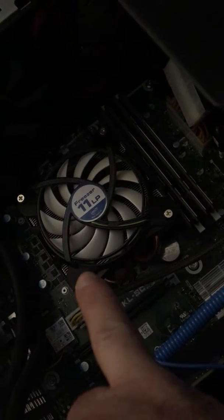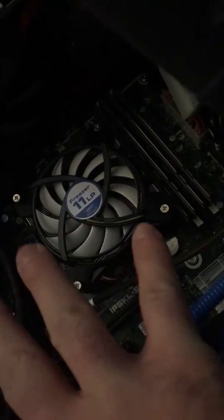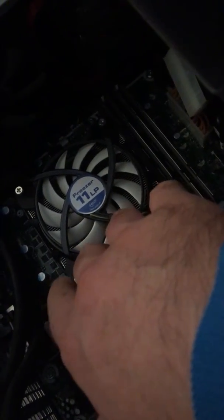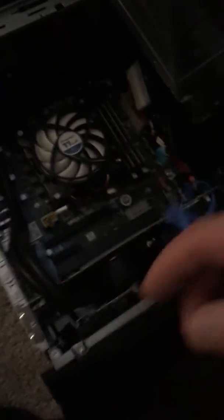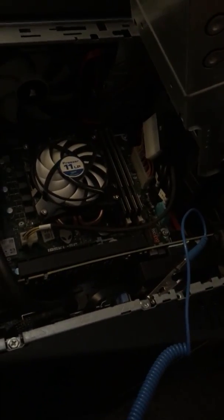Put the new paste on top of your new CPU, and with a clean heatsink and fan, put it back on the way it came off — remember the star pattern. Plug it back in and you're set. It's not that difficult as long as you're careful — it's not a big deal.